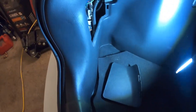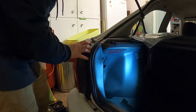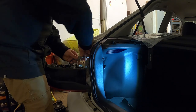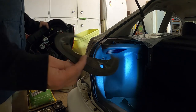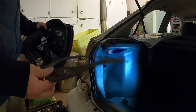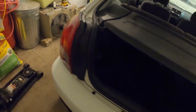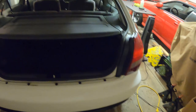In order to get the taillights out, I removed that little cover and there should be four nuts to take out. Get those out, the taillights come out, and we'll replace those gaskets. There's the old gasket — seems kind of brittle and dry, so hopefully replacing it will help seal it up better. Now we've got both taillights put back together with the new gaskets. Would help if I had a couple more screws on that side to seal it up a bit more, but I think that should be better — hopefully no more water in the trunk.